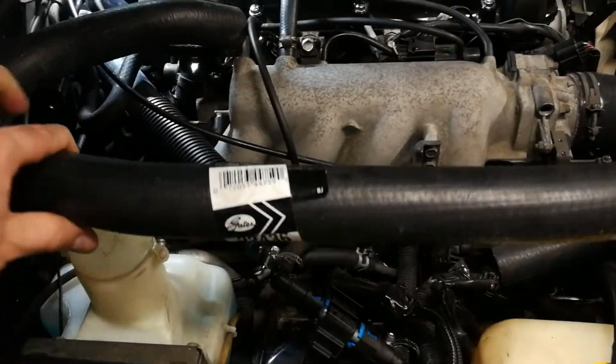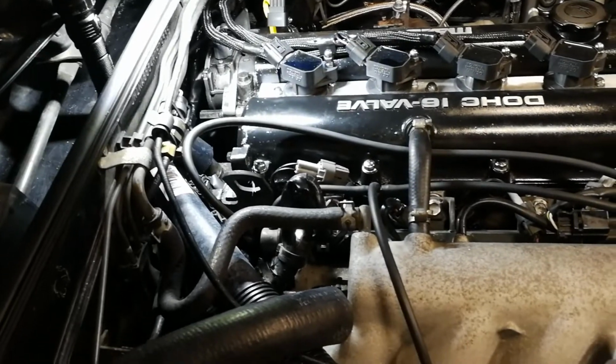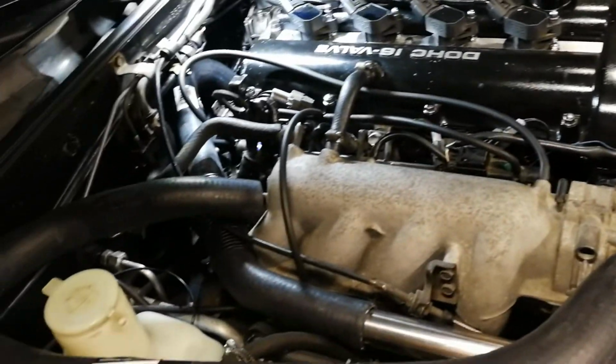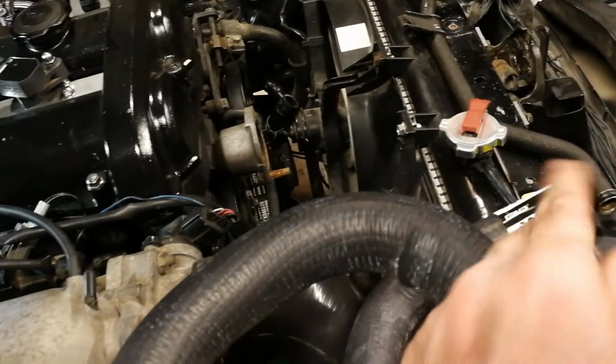So for hoses, originally I was trying to use this hose, which is used on a lot of different reroutes. It's a single hose solution that works with the spacer style. Unfortunately, this doesn't quite work if you're reusing the housing at the front, because normally that type of reroute uses a Kia water housing, which is the same size, but it sticks out more horizontally like this. It comes out like that so that this attaches quite well, and then it routes around the engine, and then it comes up, and you can have one hose.